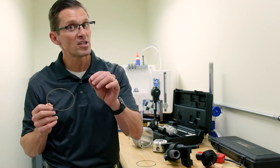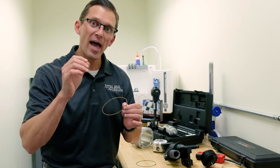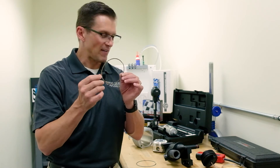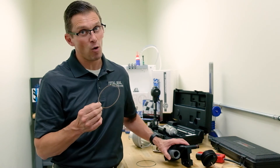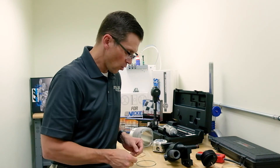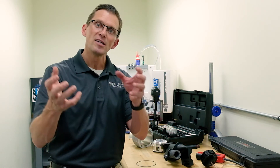I can go down to 10, 7, or 8 pounds of tension — cut that tension in half — free up horsepower and improve fuel economy. But if I don't have this working properly, my oil control goes out the window. You either have to have high tension to control the oil, or you can use the air-oil separator creating vacuum to help assist the ring and get the benefit.